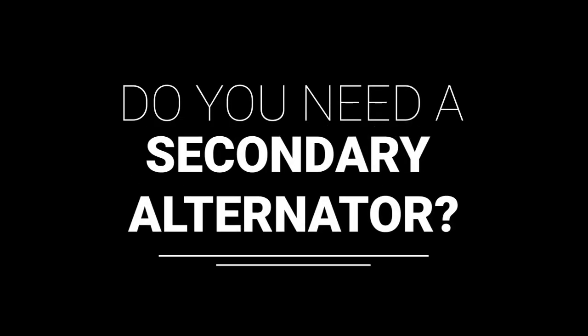In a system that uses significant power — like when the AC is running — it's worth thinking about how to get more power into the system. You could add more solar panels, but roof space is limited and sunlight isn't always reliable. Another option is a secondary high output alternator, which is what we're testing today. This particular van can draw 70 to 90 amps when running, and solar alone isn't going to keep up with that demand.